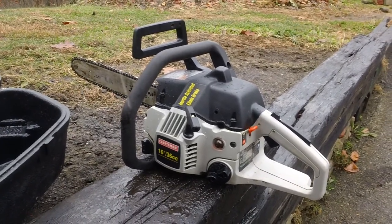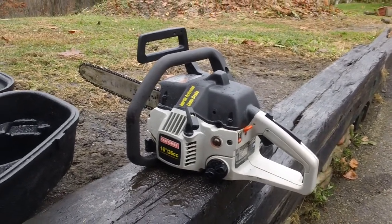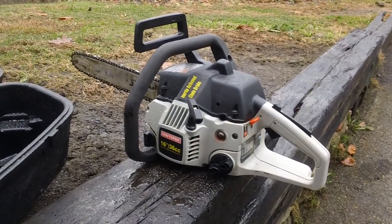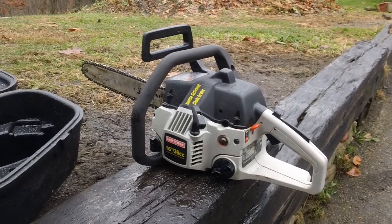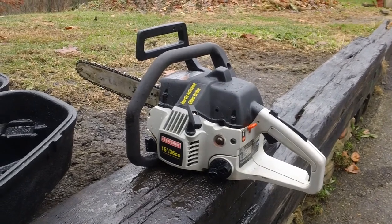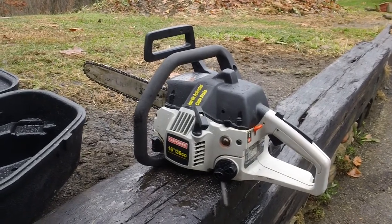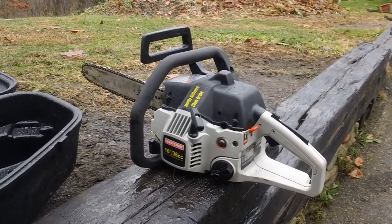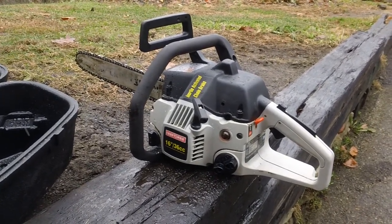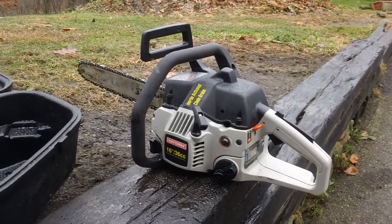And that's no joke, because of the age of the machine. Anytime you get an older machine like this one, you're going to have problems primarily with the fuel lines, the carb, and also the air filter, if it's still intact, because gasoline slowly deteriorates the air filter surface. So always replace your air filter if it starts deteriorating over time. That's the one recommended thing you should always do after about 5 to 7 years, if you plan on keeping your machine for any length of time.